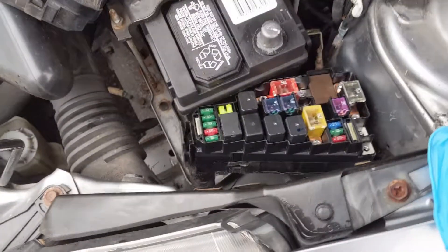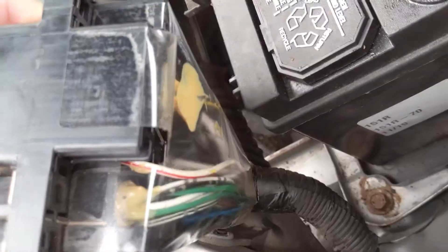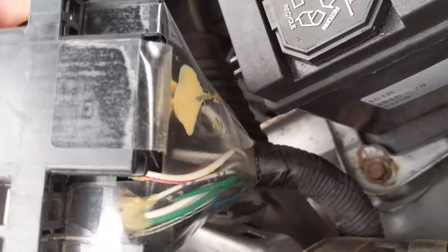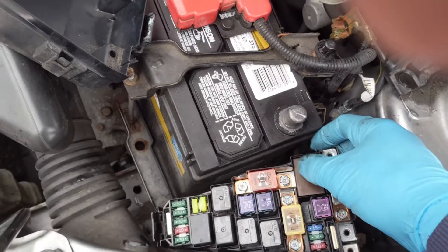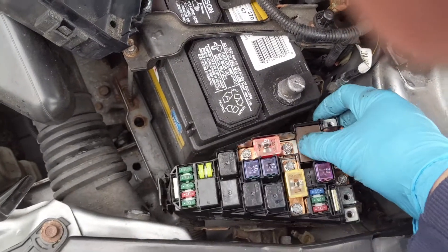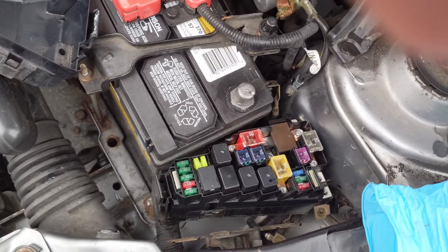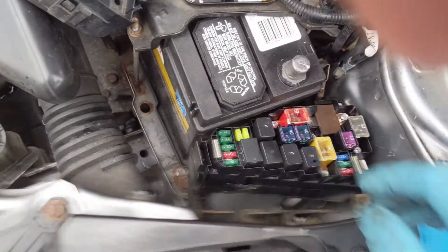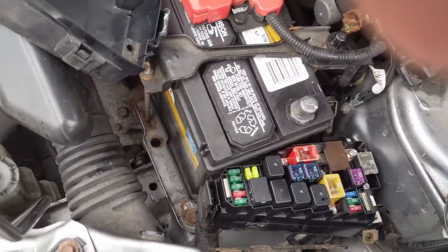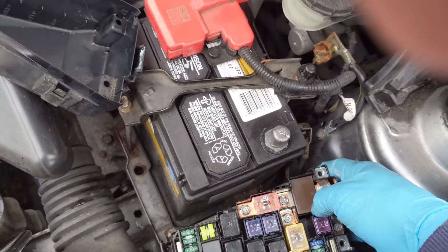What I'm about to do is peel back some of that plastic and disconnect the wire from the ELD, which is just this little brown box here — I'm trying to isolate it. This will disable it; I'll probably get a light on the dash, but I'm just confirming that this is the issue. What I've been having is the battery light flashing on and off randomly. It's very strange, but that's the only thing I can think of. I already checked my grounds — the grounds are good — and I cleaned my battery posts. Just a little video for anyone in a similar situation trying to track down a weird issue with their battery light coming on and off.